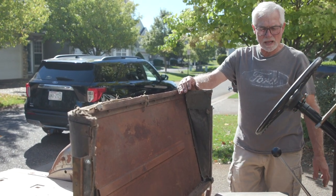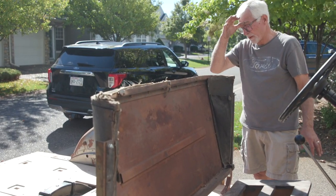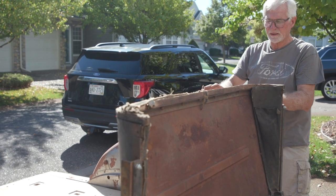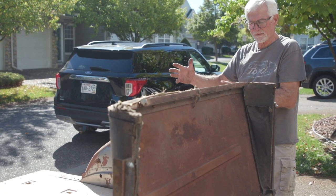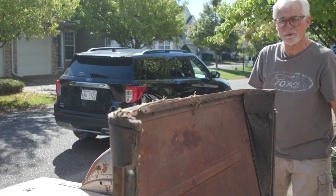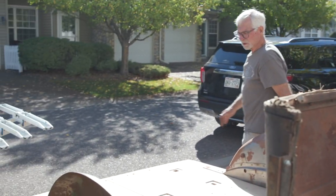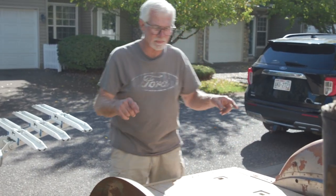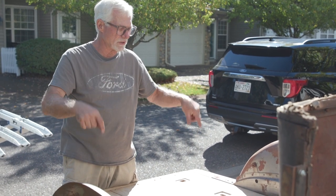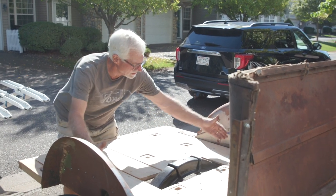So then I've been working on the floor situation. There's two parts of the floor. Yesterday I worked on the back part. I took all the boards off and then separated them off into two pieces, and then figured out from the plans that came from original Henry Ford, he showed where all the bolt holes were supposed to go. So I compared all of those, and then I compared with the actual holes in the frame where all the bolts go down. Got it exactly centered on the frame on the end piece right here, and got that all squared away.